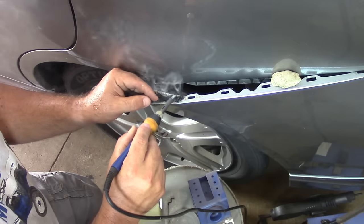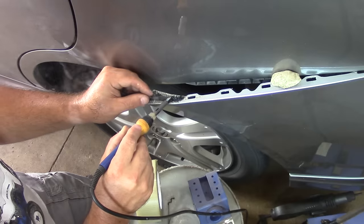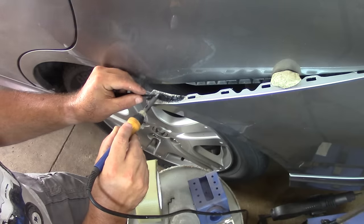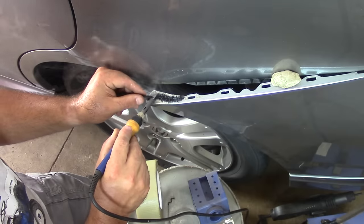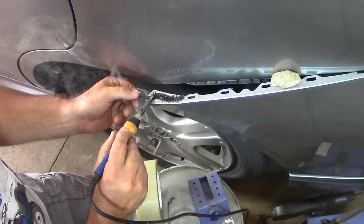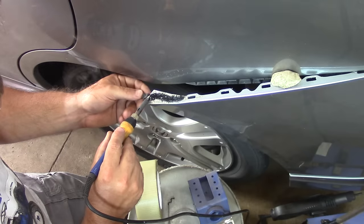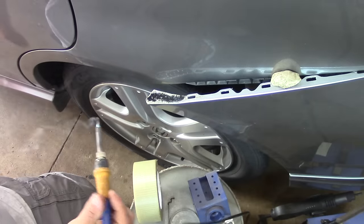We'll melt this filler in and I might come back with the heat gun — that's a nice way to straighten things out if the plastic warps. All I'm doing is piling this on; it's not hard to do. The plastic the bumper is made out of is a really nice flexible plastic that melts very easily, so it's pretty easy to work with, and the coffee can lid seems to be bonding real nice. I'm trying to build it up here because this is where I need to drill through. I'll let this cool and see how stiff it is.